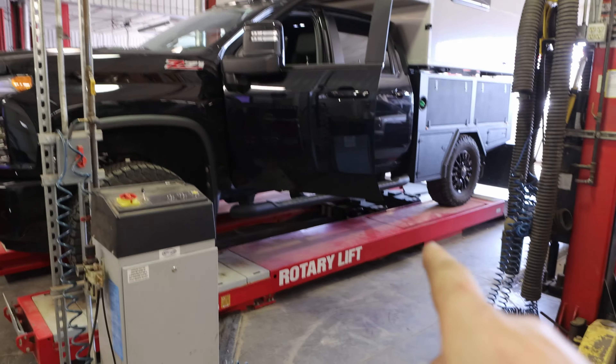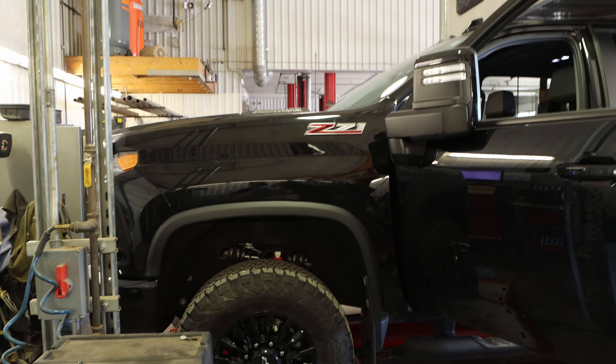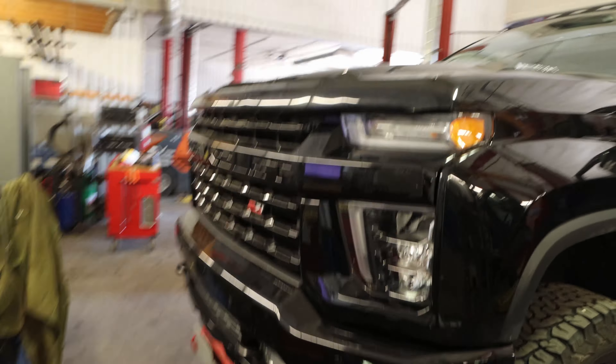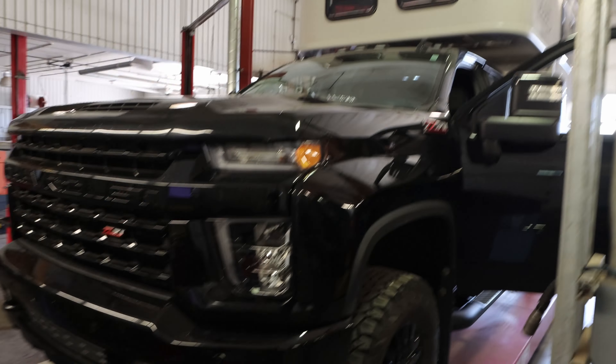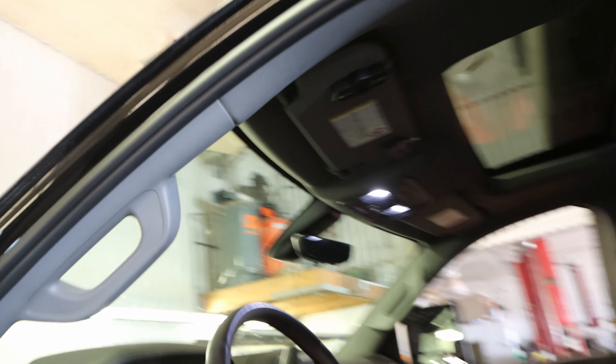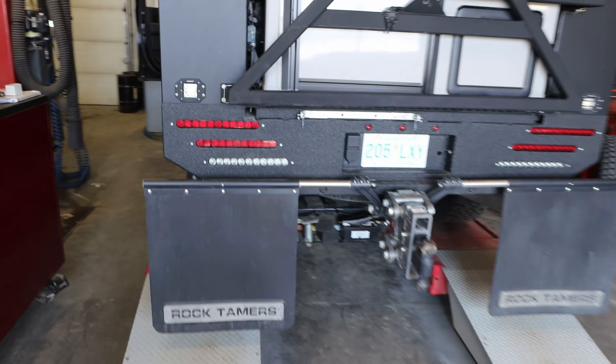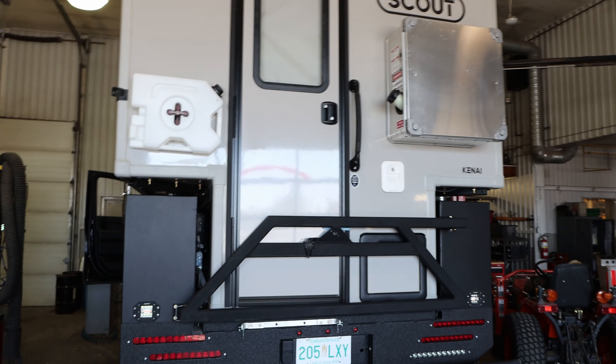We finished up the last bit of the service — aired up all the tires, reinflated the spare, greased all the front end and drive shafts. Checked the oil, topped it off, threw a splash of coolant in there because she was just an OCD amount low. I've got the air brake controller just clipped to the visor and we're good to go. So there you have it — an airlift auto-level system and a full service done on the truck with the camper in it, which is way better than rolling around on the ground in the driveway.